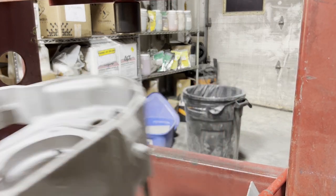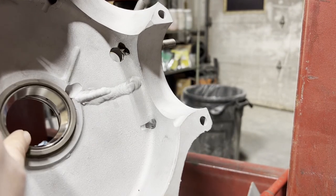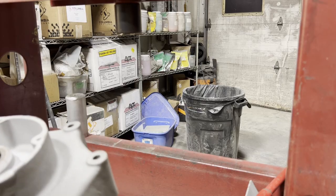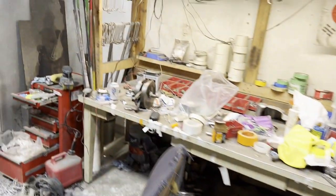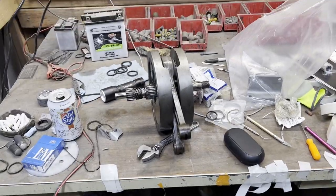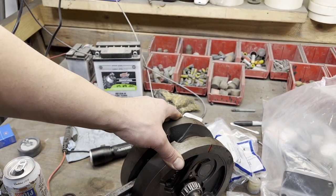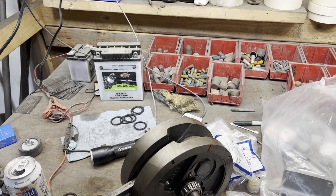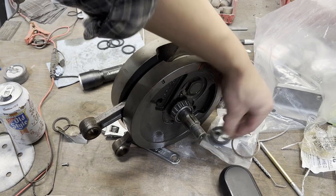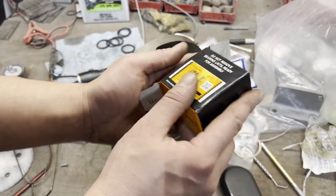Our race is installed, bearing comes out. The new sprocket shaft race is installed — it's flush on the snap ring, exactly what we're going for. Now a little bit more cleaning, then we'll put some assembly lube through some of this stuff before we actually install the bearings. Here's our Timken bearing — this is a brand new bearing. I also forgot to bring the assembly lube, otherwise I would have tried putting all of this together. Here's the new bearing and the new spacer in the box — this is all a fixed kit. Do not mix and match these.